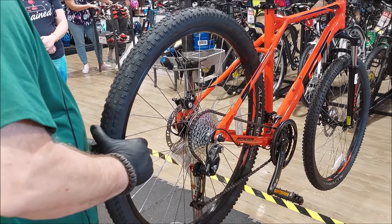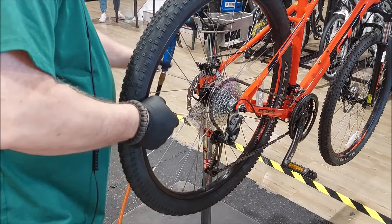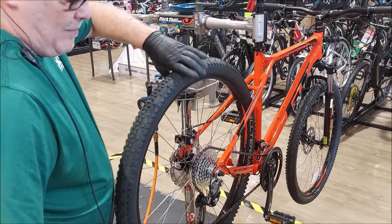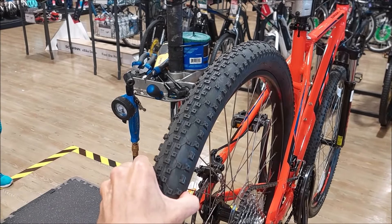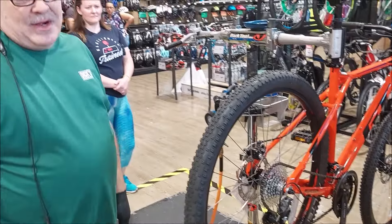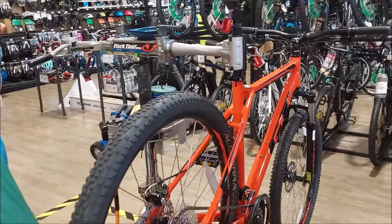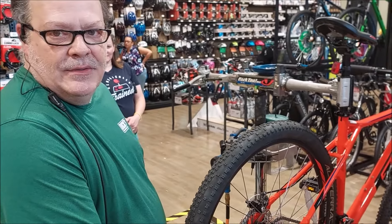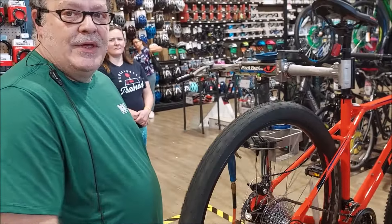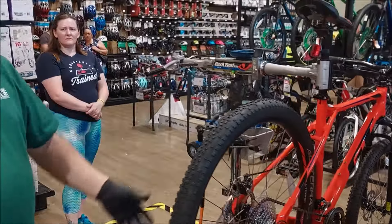Out on the trail if you need to check your tire pressure without a gauge, put your hands on the tires regularly to get a feel for what 'full' is. Anything firm where you can squeeze it is about five pounds below max. There's a firmness and rigidity, but pressing your thumb in you'll feel a very minor deflection. You want some deflection — too hard and you're like a ceramic box hitting bumps; too soft and it's a squishy balloon.